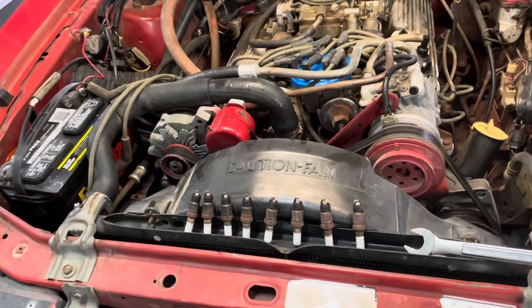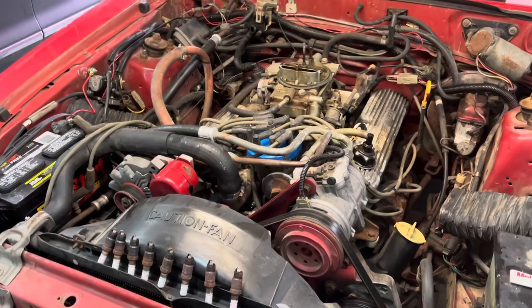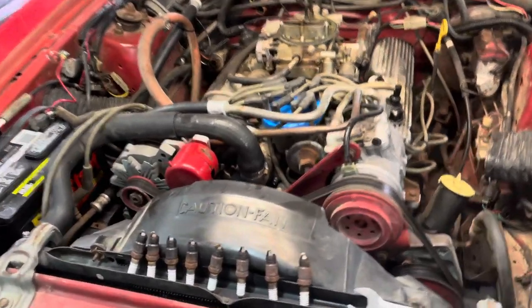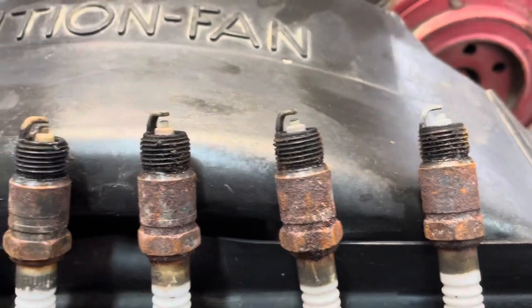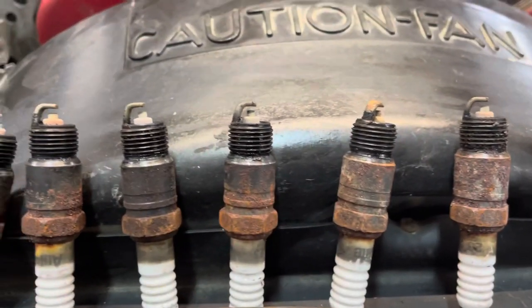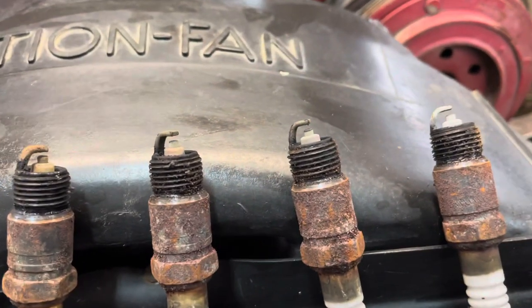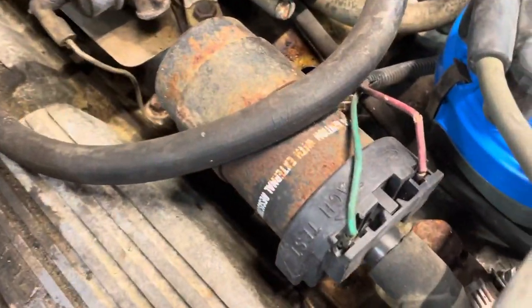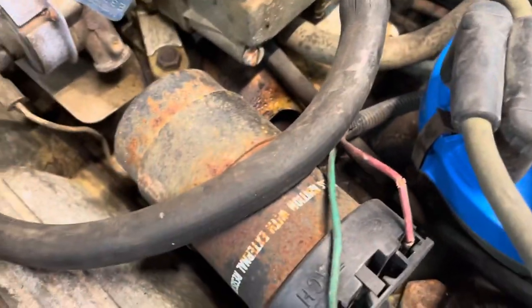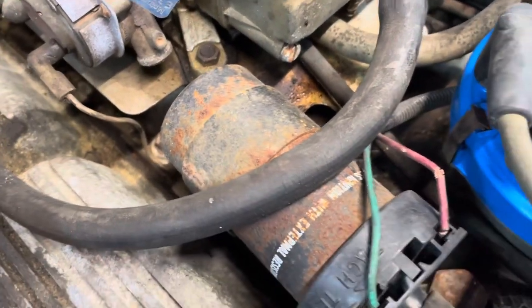It's Sunday morning. I'm out here working on this misfire. I thought I'd put a new set of plugs in it — if that doesn't work, we'll put new wires on it. Just got all the plugs in. Here's what I took out — they don't look great but they don't look perfect either. Got those replaced, now I need to finish hooking up the plug wires. Next thing I'm going to do is try to deal with that broken coil wire.